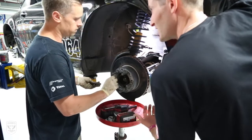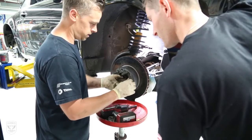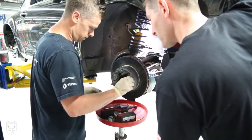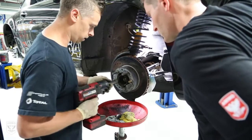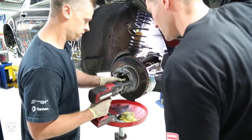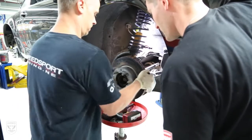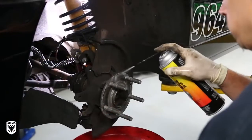So instead of taking a sledgehammer to a very sensitive part of my car? Yep, so instead of beating the crap out of the hub, I'm going to screw these in here, and it'll work it off. Oh, so the bolt is pushing the... Yep. Ooh, nice. Okay, that's the easiest way to...